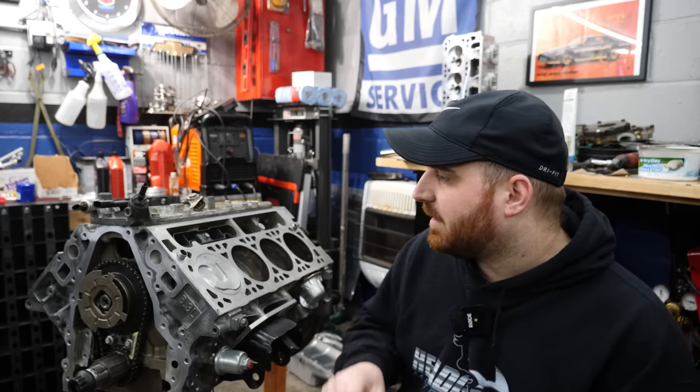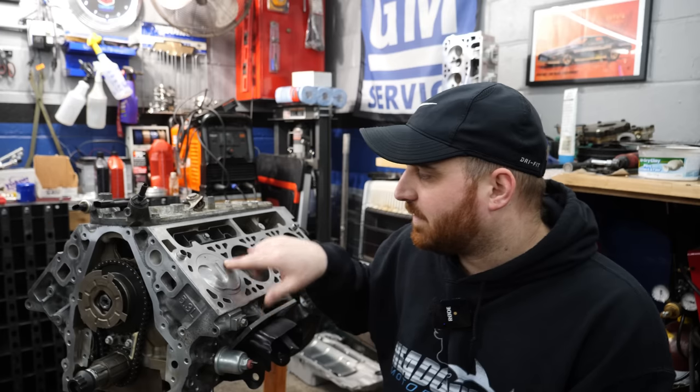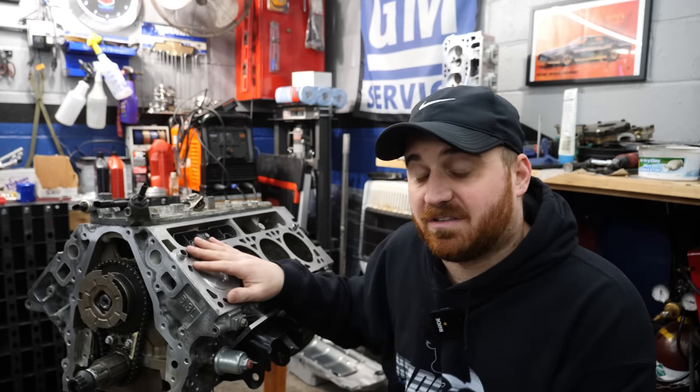But yeah, what we're basically going to end up doing is just notching the pistons to give us the extra 15, 20 thou clearance that I'm looking for.